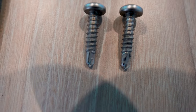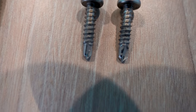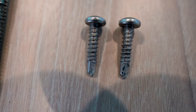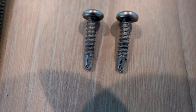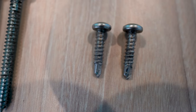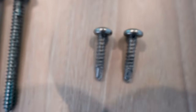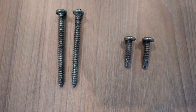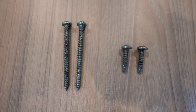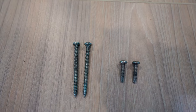And these self-tapping screws, if you look at how those work, they basically just drill through and then thread in. The problem is the holes that they drill through when you've got them in a power drill aren't very clean. And half the time, those things drill such big holes and you don't get much bite from those threads and then they just strip out. So Airstream, you could improve here. This is a case of something well designed and not well executed at the factory. They could have done a better job.